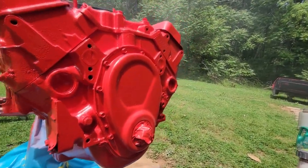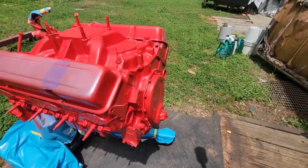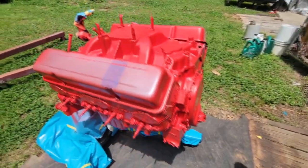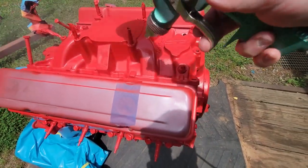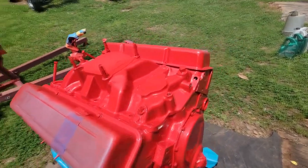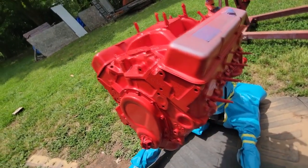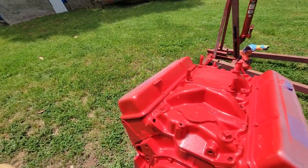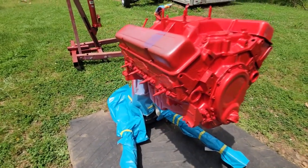And that's about the sheen you're gonna want to get. It's just a little bit shinier, but you don't want to run it anywhere because ain't like you can wet sand and buff the engine. So you can see right here how it's a little flat. Look how that gloss pops. Good gravy, gonna make his $20 truck look like a Bentley or something. What I'm talking about. All right, I'm gonna stick y'all over here on the post so I can get my respirator on and save a couple more years on my life.